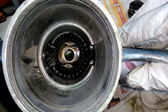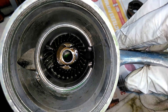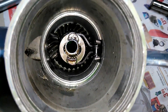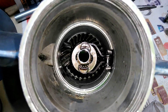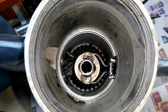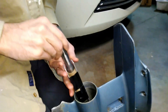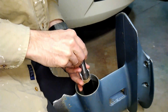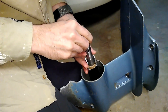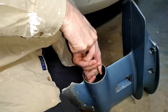I have the bearing, the forward gear, and the pinion in place with the forward gear positioned so those little ears will hold the clutch dog in neutral. I have the shift lever, clutch dog cradle, and clutch dog positioned, and I tested it with the bare propeller shaft to make sure it's all lined up. Lining up the tool, lining up the splines on the propeller shaft and the clutch dog — I'm going to hold the tool in place while pushing down.